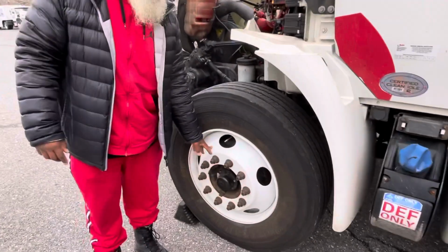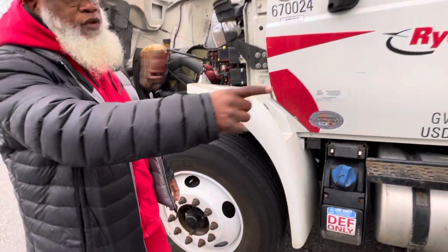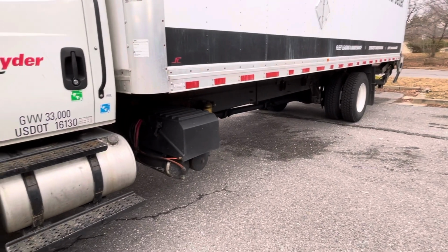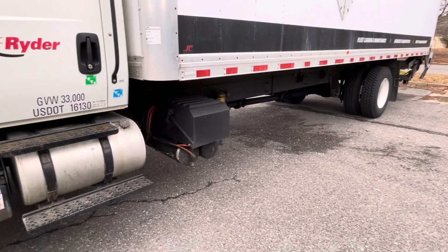The front steering rim is not cracked, not broken, and secure. No illegal welds, no loose or missing parts. I will inspect the drive axle rim the same way as I inspected the steering rim, with the exception that that is a bud rim and there should be no debris in the middle.